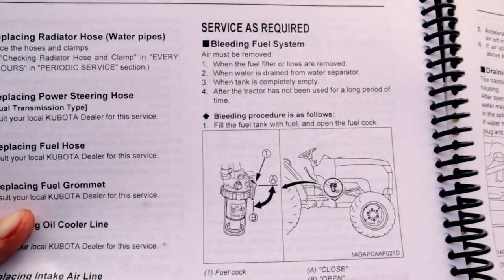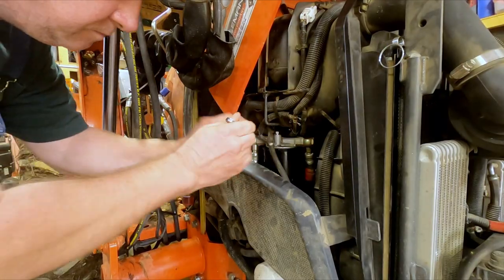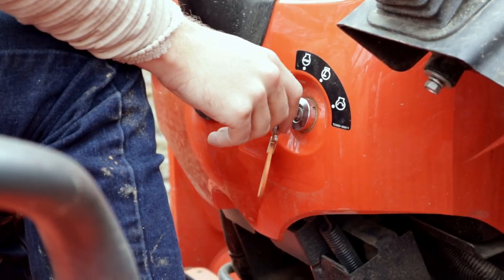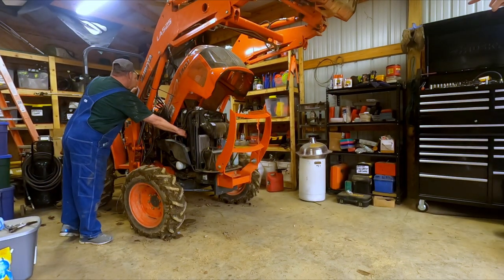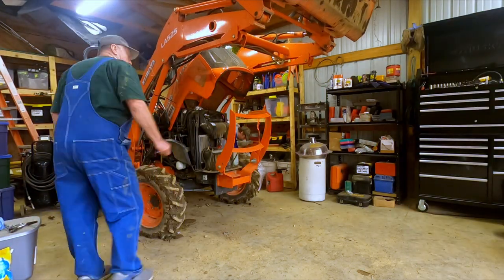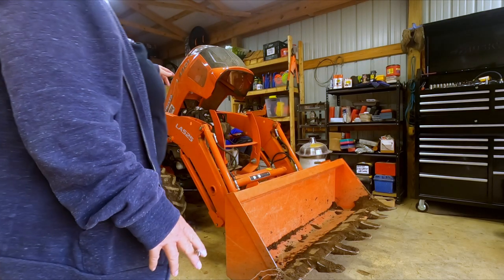Now that you're reassembled, it's time to bleed the fuel system. Turn the petcock to the on position, then unscrew the tiny bleeder on top of the fuel filter. Turn the key to the on position for around one minute to prime the fuel system. You will be able to watch the fuel cup fill as you sit there. After the fuel cup is full, let it sit for a few more seconds, then shut off the key and close the air bleeder on top of the fuel filter. Once it is full, the manual says to bump up the throttle slightly, turn the key over, and let it run.